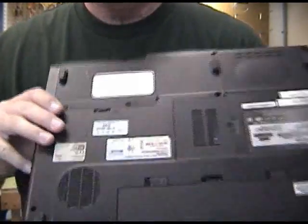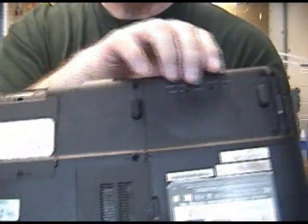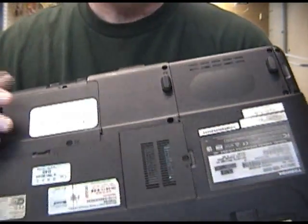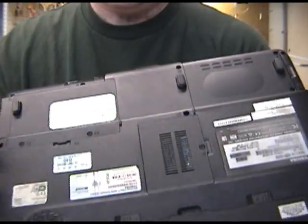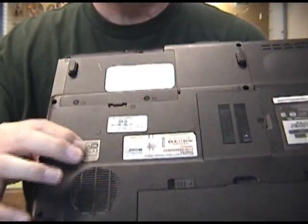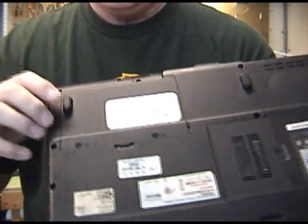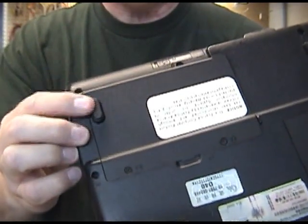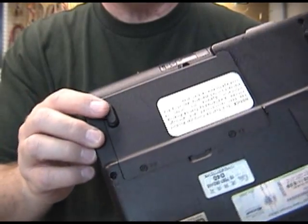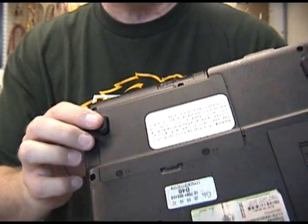Other than that you'll have a whole bunch of little screws all the way around the bottom of the case — they all have to come out. Find them all. You want to push your finger on some of these labels because sometimes you'll have a screw hidden underneath a label. Sometimes you have to take these little rubber feet off to get a screw out from under there.